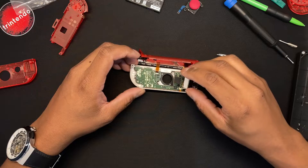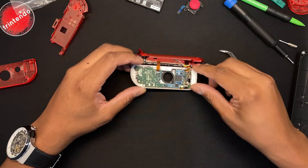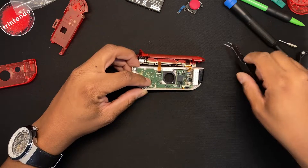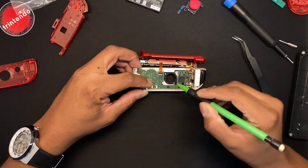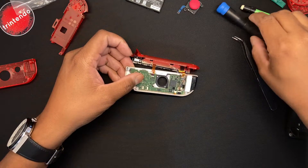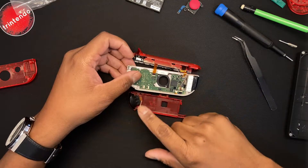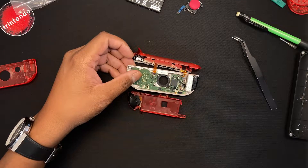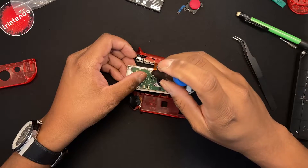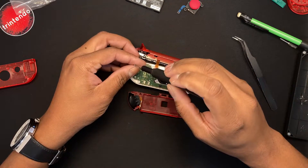With the new buttons back into place, make sure you put all the rubber membranes back on before dropping the motherboard onto the new shell. This should line up very easily. There's the sensor and the HD rumble — the metal plate goes directly next to the screw hole, so that's how you know it's in place and it should be flat. Use the middle plate to see where you should be screwing: it's not the two top screws, it's the two screws closer to the thumbstick.